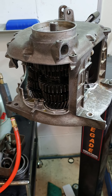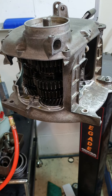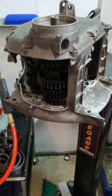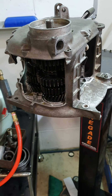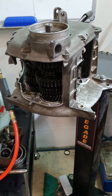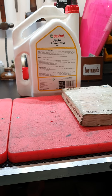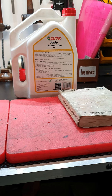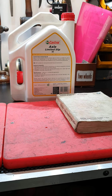90-weight oil is what I use in my own bikes. It's a bit clunky on a cold day when you first start it up, a bit sluggish, but once it warms up it maintains a better noise output than multi-grade oil, even 80W90 Penrite which is probably one of the better ones around. In all the years using that oil, in all the gearboxes I've done - I've done five in the last eight days or so, and I've got four or five here still to do. One is a mission - a gearbox that's been full of water. Another was purchased with good gears but put together incorrectly, smashing the back housing, so I've got to make one gearbox out of two.